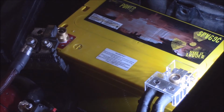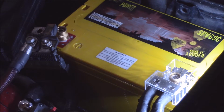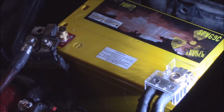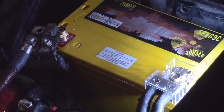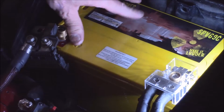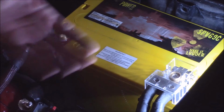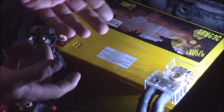And the primary reason, one more time, that you want to use the BIG3 kit is that when you're hooking up power systems, you went out and bought yourself a battery, and bought yourself amplifiers. Let's say you've got a total system wattage of roughly 2,000 watts. So you have 1,500 watts on a sub amplifier and 500 watts on a 4-channel, and you say, okay, I've got that, no big deal. I'm going to run myself a 4-gauge, or an aught power cable, to the back of the car. And you say, well, that's wonderful.